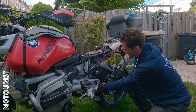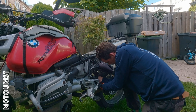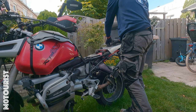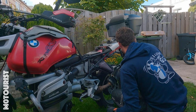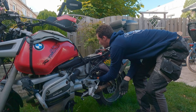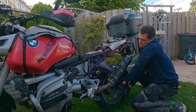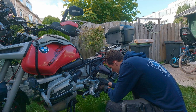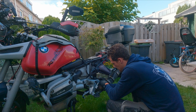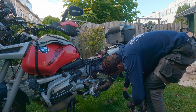And without lowering the exhaust. The exhaust needs to be dropped off as well. I don't think we can get it out — the back wheel needs to come off as well. Next thing is the hydraulic preload adjuster that needs to come off; it should be simpler because I've removed it in the past. And there we have one rear shock.